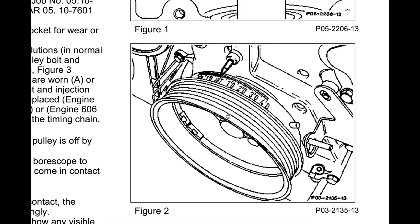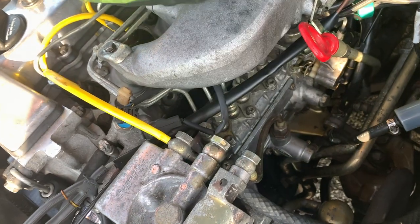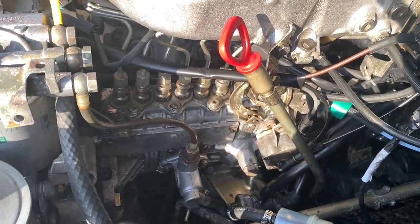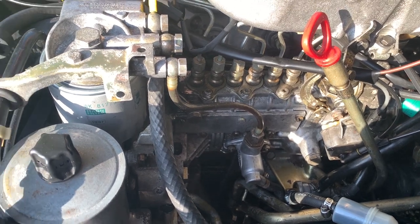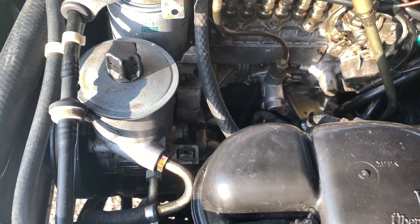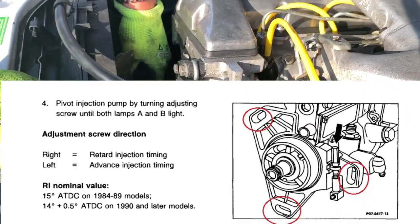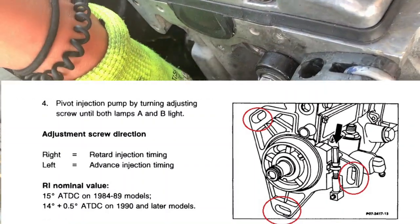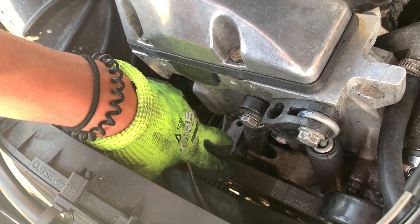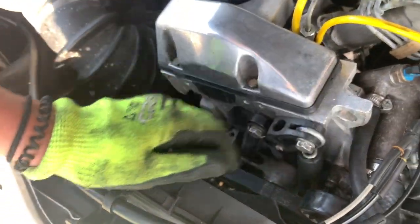When you're at after top dead center, the little nub on the side of your injection pump should be showing. This is your injection pump right here — the 4701 model, which is original to the 3.5 liter. From what I've read, the 1001 model that came with the 3 liter is also interchangeable, because they basically produce the same horsepower, so just take the best pump you have. This was one thing the mechanic did wrong on this project, and we had to take out the injection pump and redo it.